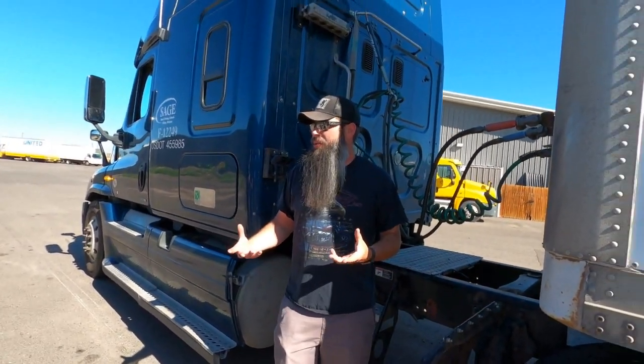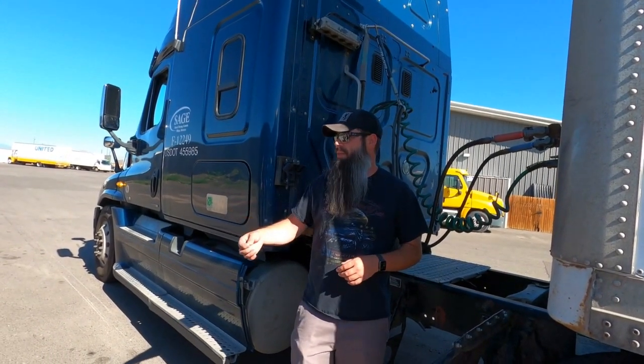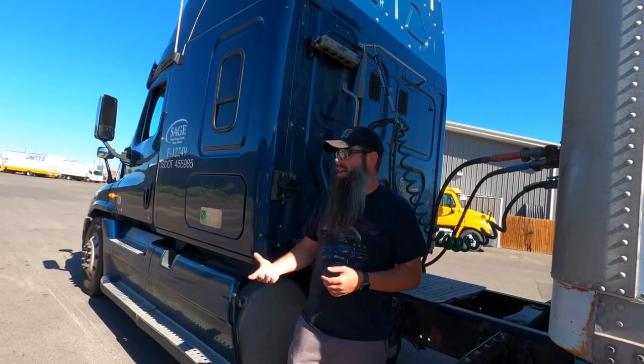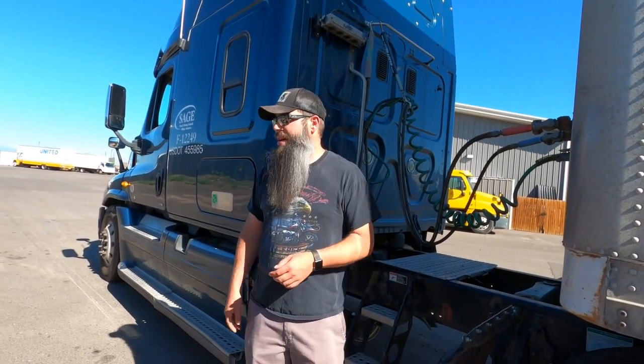If you really question it or if you're worried about it, you can keep a set of chocks with you, right? If you get some wheel chocks and put them under there, that is fine too. That's just taking an extra step to make sure that you're safe, if you want to chock the wheels. You'll see on docks and in yards, they'll have chocks that are sitting on the ground. You could throw that in front of the wheel. That's probably a good practice for you.